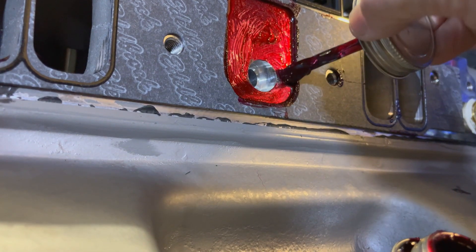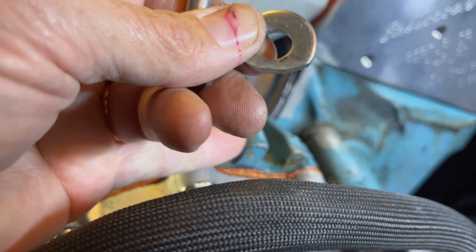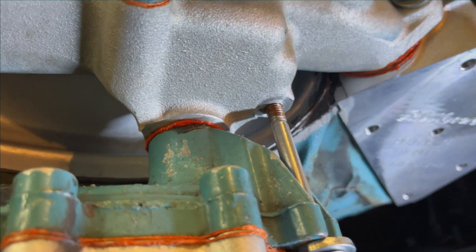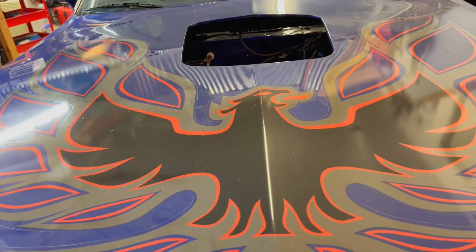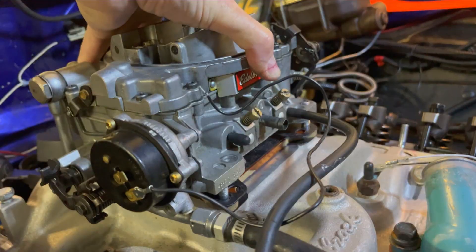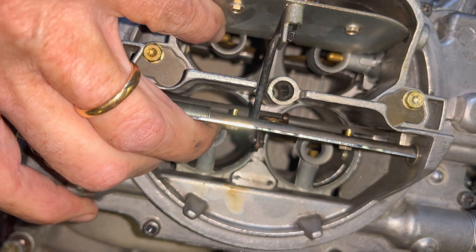The exhaust crossover insert goes here. Drop the intake. The perimeter bolts are all in finger tight. I lost the specialty washer that goes here so I just ground down a standard washer. Torqued to 40 foot-pounds. That's not the cleanest install I've ever seen, but the thing about Trans Ams is the bird is the word and the hood stays down at the car shows. Don't forget to grease your carburetors — maybe a little too much grease. Four barrels — this baby can drink gas when those things are open.